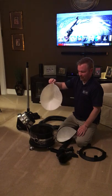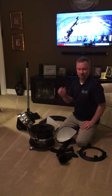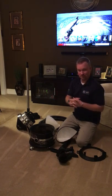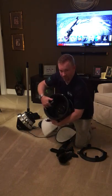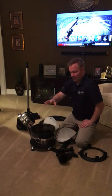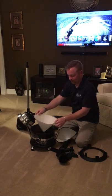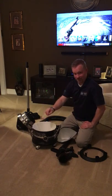The cellulose filter cone is designed so dirt can't pass through it, unlike a traditional filter bag. Filter bags have three to seven layers stacked together, and dirt clogs the pores causing you to lose airflow. With the Filter Queen, dirt is sucked in, spun around the container by a deflector, and the very thick cellulose cone stops it. If you suck up marbles you can hear them spinning — that's what your dirt is doing. I've never opened a Filter Queen that had a dirty filter cone, even on heavily used machines; it always stays white when installed correctly.